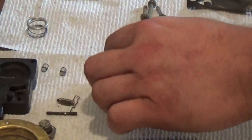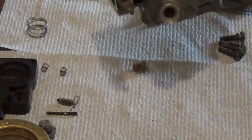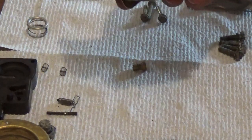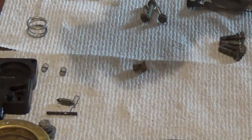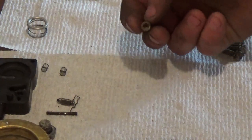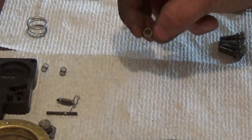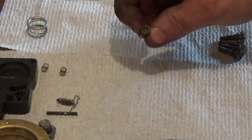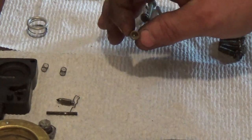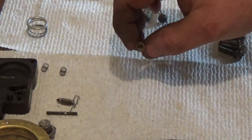This part right here is the main jet. The main jet goes inside right here and it takes a five millimeter Allen key to pull it out. This little jet can cause you a world of problems if it isn't clean. Now I'll admit I'm not reusing this carburetor — this is just for YouTube purposes to allow viewers to see where these potential problems are. In all honesty this would probably work just fine — I can look right through it and see that the passage is clear. But I would generally do a more thorough job cleaning the carburetor and all these little jets. So keep that in mind — this is the main jet.